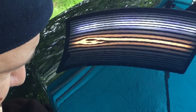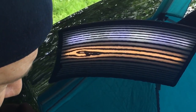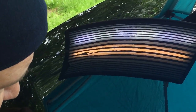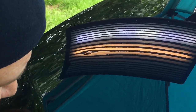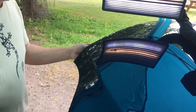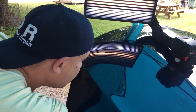Coming through the middle of the valley, straightening up those lines — real soft pushes. With the twist and the pry, I guess I'm putting about four pounds of pressure on it. Maybe that one was about five or six because it kind of made a little high spot. Any of these high spots that I push too hard on, or it slips, I can come back and tap them down.